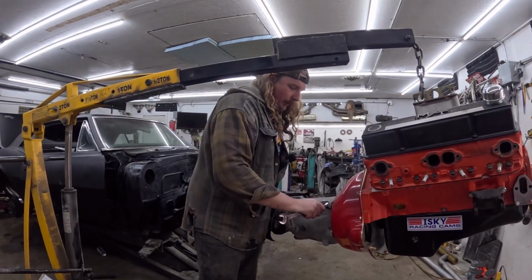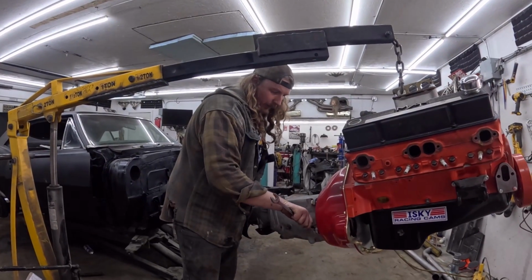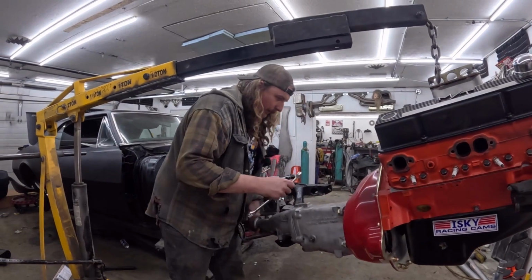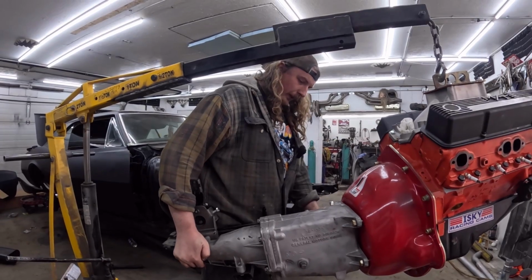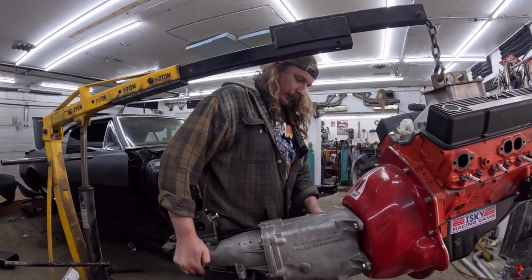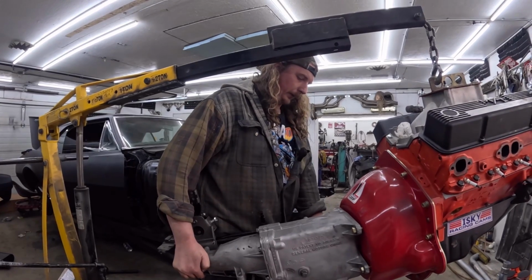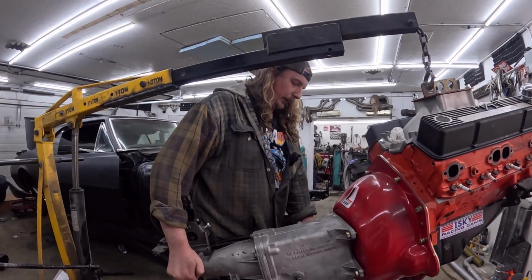If it's not shaking, I said do not pull it in, because this side was just tight. Now it's tight there. Well, it's a little tight. Give it a shake. And see, it's loose on this side now, so give it a snug in the bottom. Just work your way around until it's in. Take your time, go extremely slow. Choke up the wrench so you're not putting any load on it.